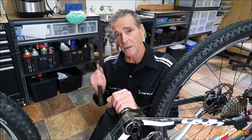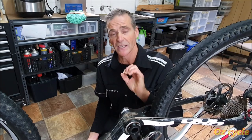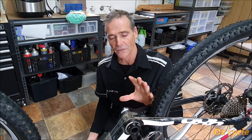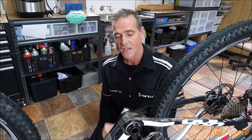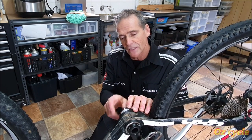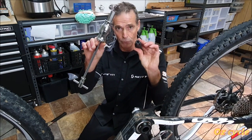The other problem with hitting a bearing out is impaction force. With carbon fiber frames especially, they're getting thinner and lighter these days, you could start a stress fracture in the carbon and that will lead to a crack, so you don't want that. So if anything, you need to tap it out, but even then, it would be nicer to have a softer way of doing it. And a softer way is to pull a bearing out. So if you can get a way of pulling a bearing out nice and evenly, nice and slowly, you don't use any impaction. Here's a tool that pulls the bearing out.